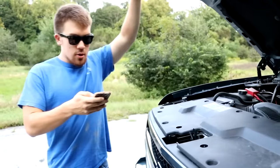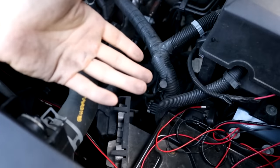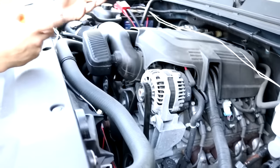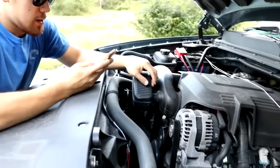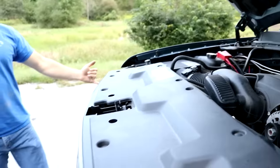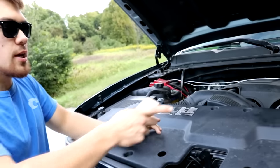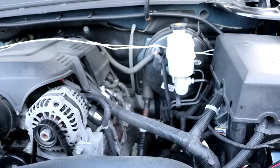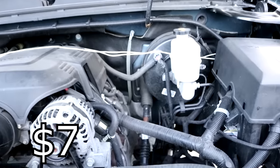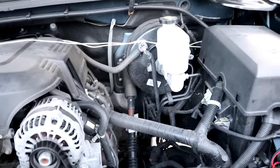For the fog light wiring: the harness was 25 bucks. I also bought extra 20-gauge red wire — 20 feet for 5 dollars — to run wiring across this large truck. The daytime running light kit was 9 bucks, since the truck didn't have it stock. I bought fuse taps for 7 bucks so the running lights come on whenever I turn the key, even without the engine running, and a 120-piece fuse assortment for 6 bucks.